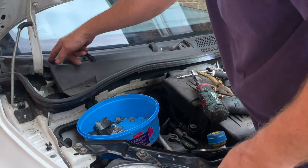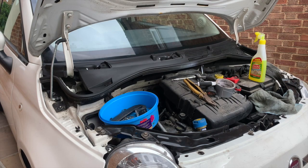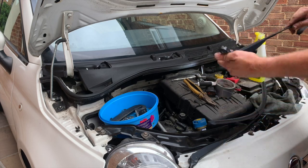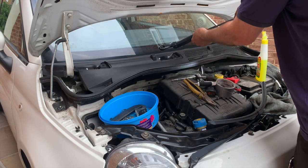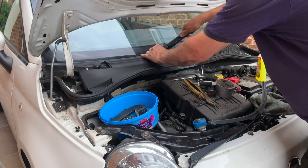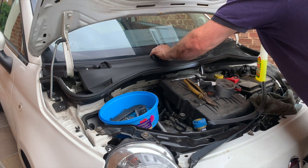Then you've got to put your wipers on. Don't forget there are two different size wiper blades - the small one goes on the UK passenger side, the longer one goes on the UK driver's side. Make sure you get them on the right way - I've done that before, put them on the wrong side. When it's extended, just push it on and it will slip on quite easily. It's on a spline so you can't really go wrong. Then bend the end of it to get it in the right place.